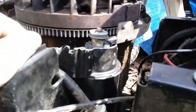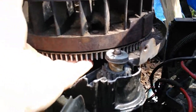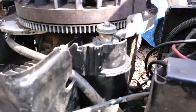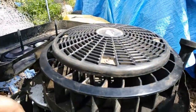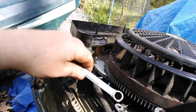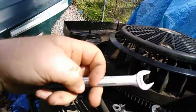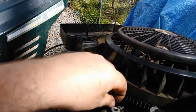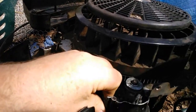I got a clue from someone else, but eventually just kind of went in here. You can feel there's a little groove underneath here, so line that up, get a half inch or 13 millimeter, and you're just going to start loosening it — just keep going even though you feel like it's going to hit. Usually at the end they're turning around; grab this side and keep going until you finally feel this thing loosen up.